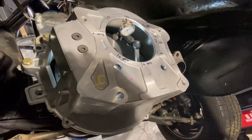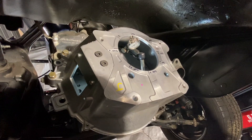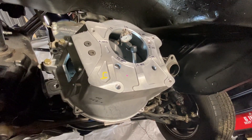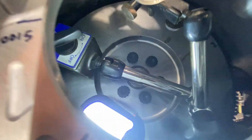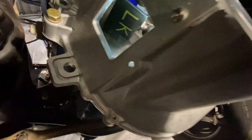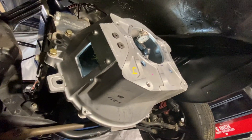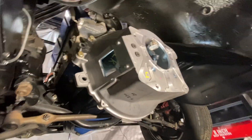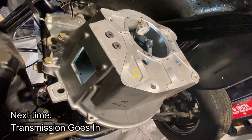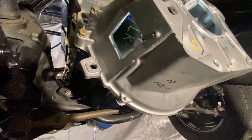This should give me years of good service. Safe to say I can put everything in now — the transmission can go in. Let's pull the bell housing back off and install the clutch, pressure plate, and all that, clean up the flywheel since it has a little rust on it. Now that I have the dial indicator work all taken care of, I can get ready for the transmission, get the clutch and pressure plate installed, and everything goes back together.